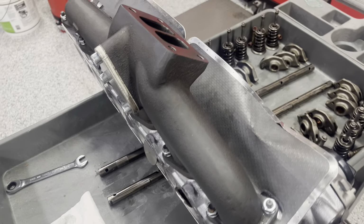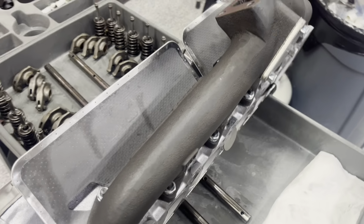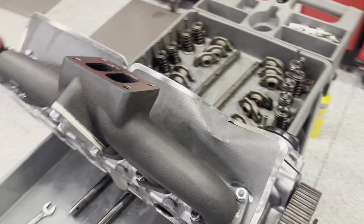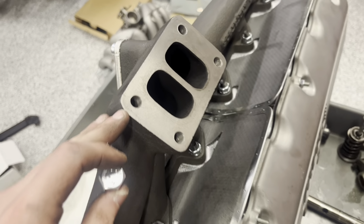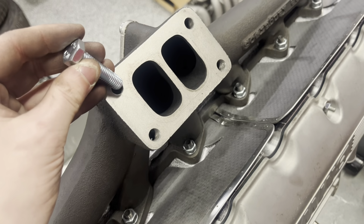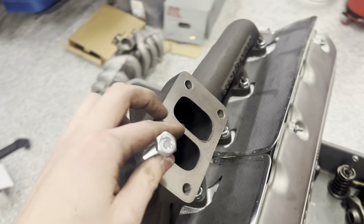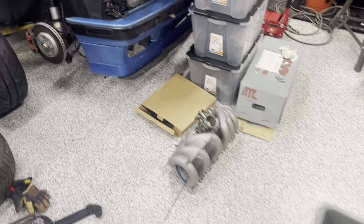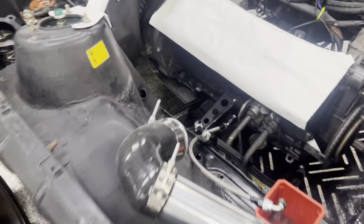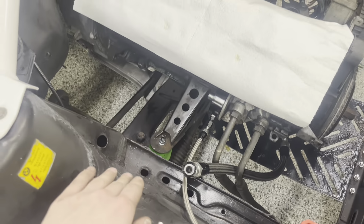All right, so now I got all these bolts tightened down and the manifold is installed onto the head. I do want to go over now how to make studs for this, as from the factory it comes with threads for an M10 by 1.5 thread pitch bolt. And from having this on the car before and mounting the turbo up, it's really close to the firewall here. I actually had to dent it in a little bit to mount my turbo up, and I'll dry mount the turbo